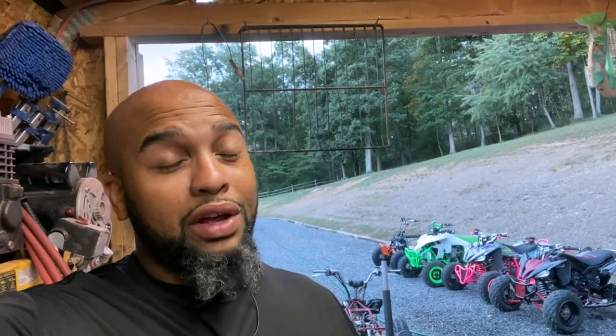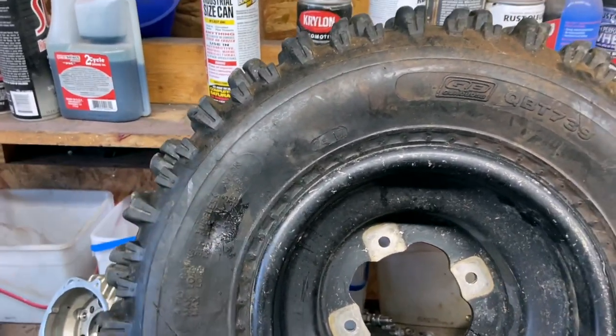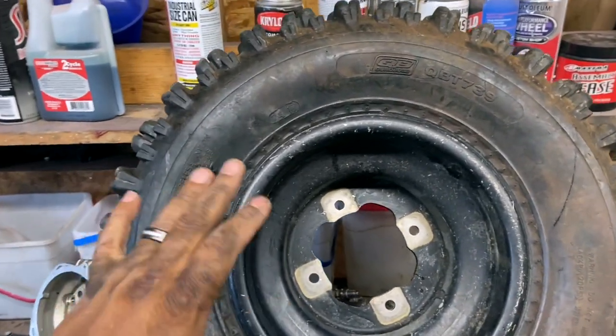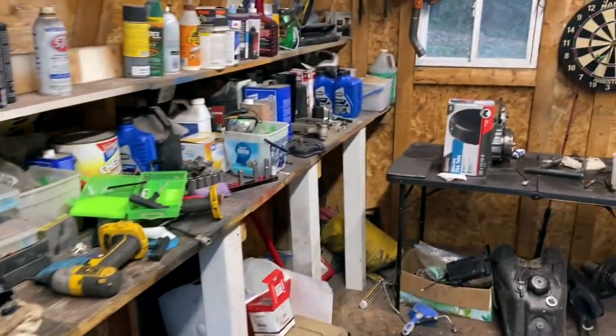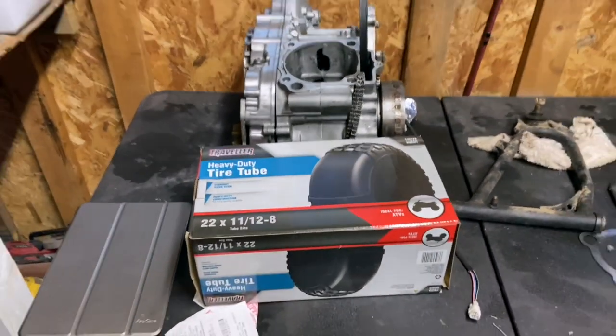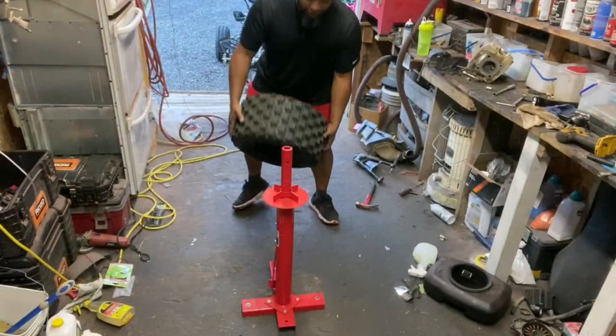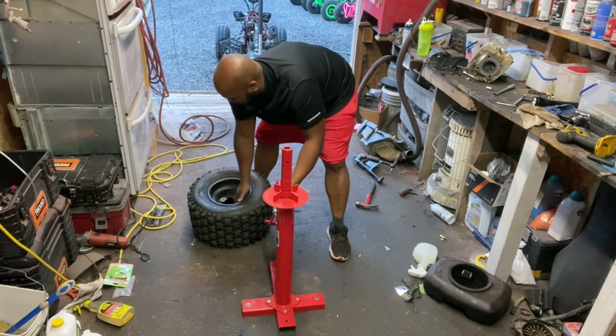What I'm working on today is I have a tire here that has some plugs in it. I've been working on trying to get those plugs taken out, put a patch on it, and it's not working so well. So I'm just gonna flip the camera around and let you see what I'm working with. Quad Boss tire right here — I've been dealing with it. The plugs were in here, I took them out, took the tire off, had a patch on the back, and it still leaked a little bit. So what I decided to do was run out to Tractor Supply and grab a heavy-duty tube, and we're gonna get that installed.